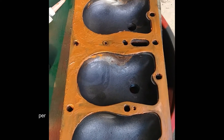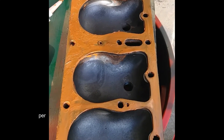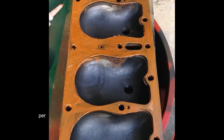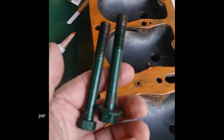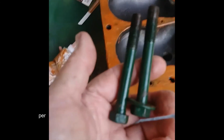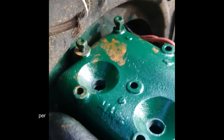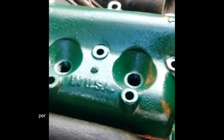What you want to do is lay the gasket down on the head with all holes lined up — put the gasket material on the head side first, then on the block side. So now we have a very thin layer of high-temperature copper gasket material on both sides, spread with a gloved finger. It's very thin to fill in any imperfections and will help the gasket stick to the head. One more trick: the two cylinder head bolts up next to the firewall have no clearance to put them in, so put these bolts in the head through the gasket before mounting the head on the engine. Then carefully line up the head and start putting in bolts very loosely — don't tighten them — just to make sure all the holes line up.